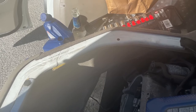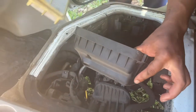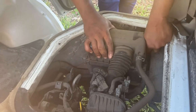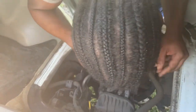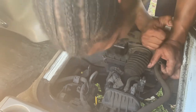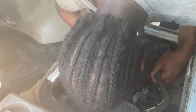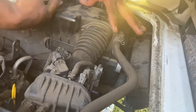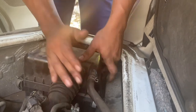The air filter is on the other side of the vehicle. Come right here — it's four prongs. Pull that in, just like that. Slide that air filter right in, close this up. All right, all right, good. Let's get these clips closed back up.